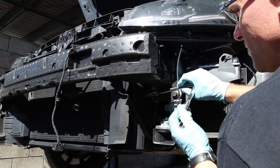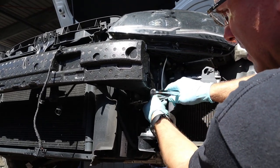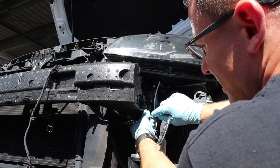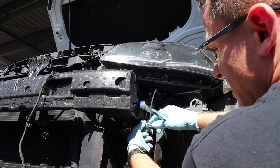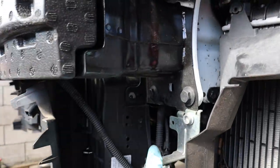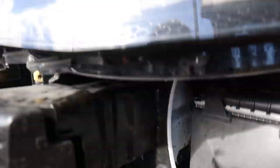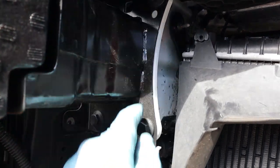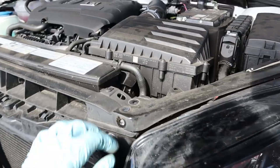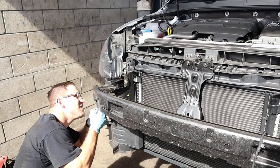Removing those bolts, then you've got to get the ones behind that are actually attached to the frame. Once you remove those bolts right up here and down here, you come up top and remove these two bolts. Following that, move into the four that connect it to the frame and that should pop right off. Not sure why the instructions want you to go for the middle ones first - maybe so you don't forget - but we're just following instructions.